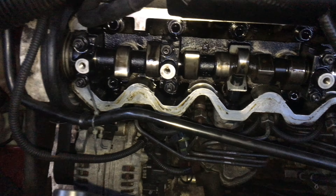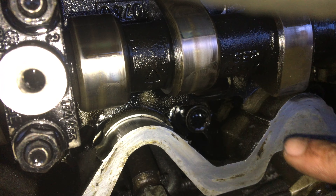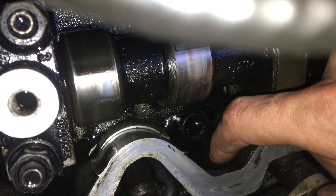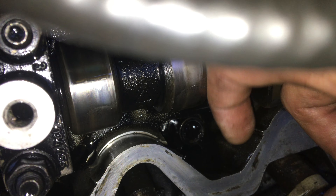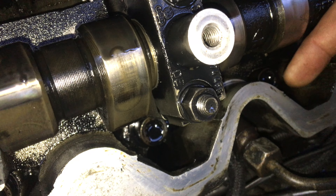We've seen the centre pop on the flywheel, both valves are up over piston one — happy days, we are at TDC. Before I show you what I found in the engine, make sure you leave some comments below of what you think could be the cause of this finding. Thank you for watching, please like and subscribe, and share the video if you know anyone doing work on their van who needs to set up TDC — it's a nice easy little process.